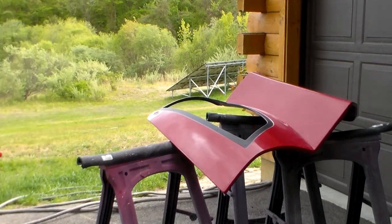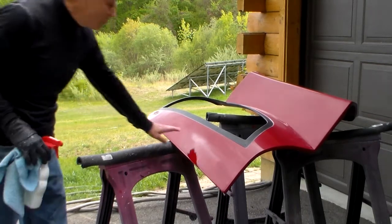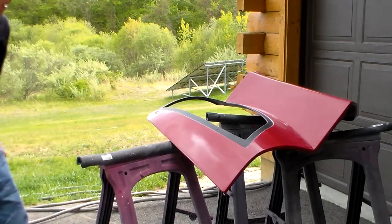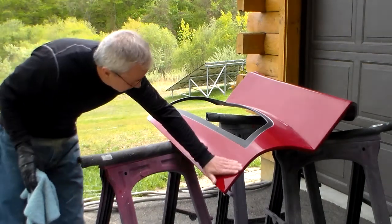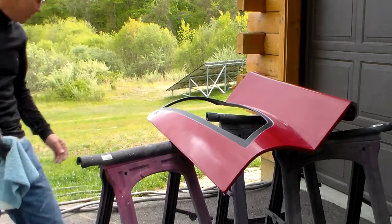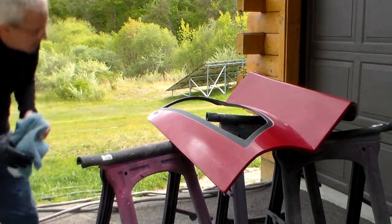This will even get more polished looking when we put the hand glaze on it. You can't wax these panels right away — you need to let the clear coat completely dry for 30 days and let any vapors escape. But this thing is just incredible. You can see the water beading right up like that.